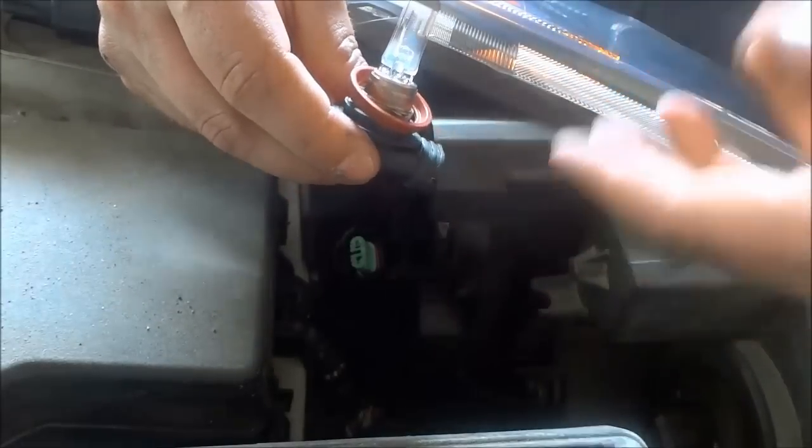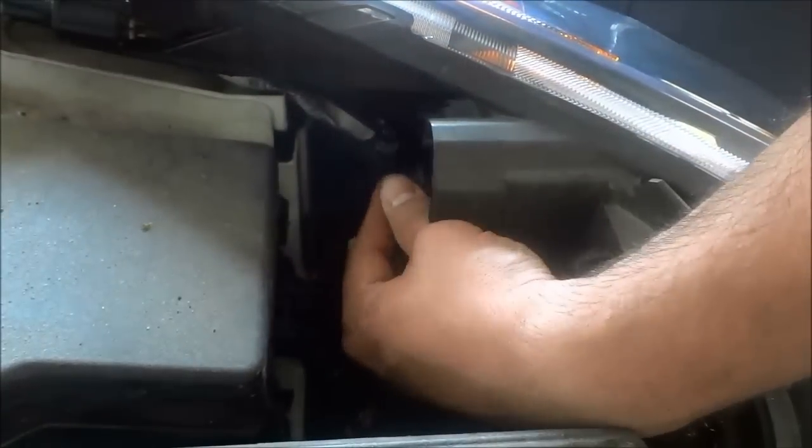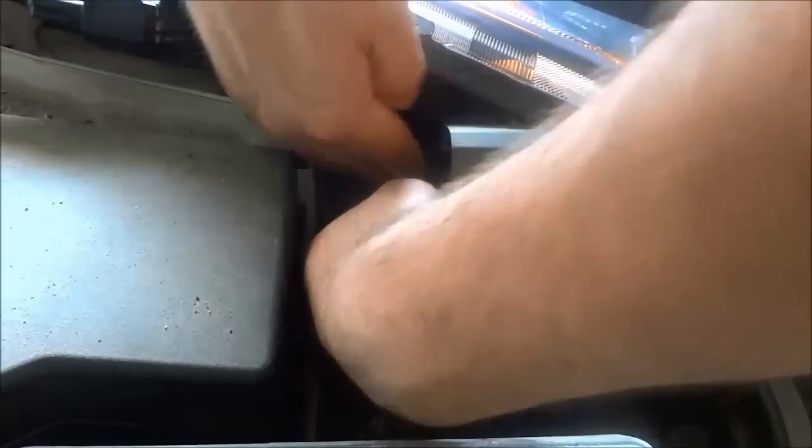If you are using a new headlight bulb, you're going to get the new one, place it back in the hole all the way in, and twist it clockwise. You're going to have to give it a little wiggle to get it in place, then twist it clockwise to lock it in place.